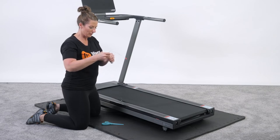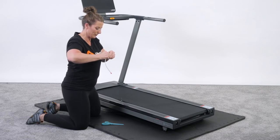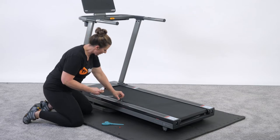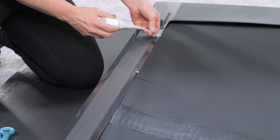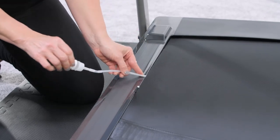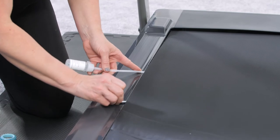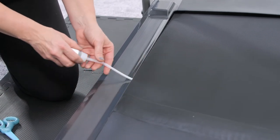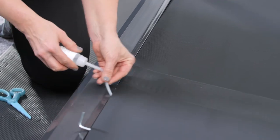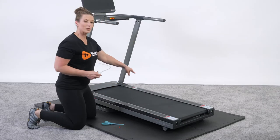Your applicator tip goes on — new applicator tips take a little bit of extra wiggle room, so wiggle that on down. Take the red cap off. From here, we're going to start all the way up here at the top, slide that underneath like such, and give it a little squeeze as we slide our hose forward. Put the screwdriver down just to maintain that gap, squeeze on in, and slide it out a little bit further. This side is good to go, so we're going to pull this out and do the exact same thing on the other side.